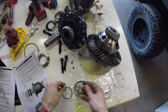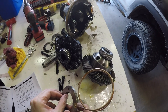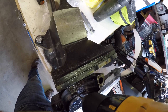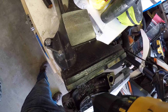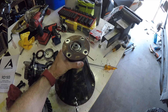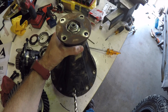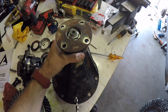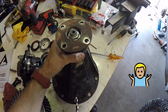Put the o-rings into the seal housing. You need to drill out one of the caps to get the air hose to the seal housing — did you remember to mark the cap so you can put them back on correctly? Get the right cap and drill a hole in the correct location so that the seal housing can sit inside at the right spot. This is also a good time to drill a hole in the housing so that you can get the air hose in and out. This requires a 7/16 inch drill bit and needs to be tapped with a quarter-inch NPT tap. Offset it to one side so that it doesn't interfere with the ring gear. Measure twice, cut once — or whatever.